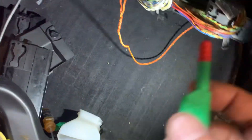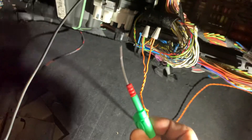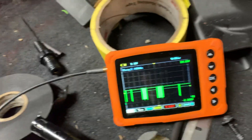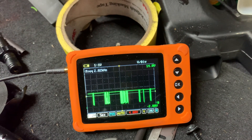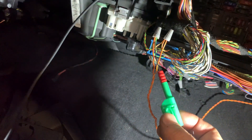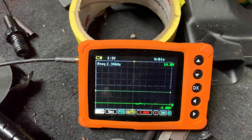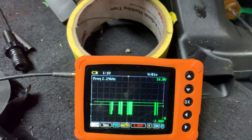So if you're looking at the screen, I'm going to take this — over here I had to fix a bus line. So if I tap in there you can look down there. Now you see the green line, the squares, and you see how the top is green. If I take it out, watch the green drops. In this case they call this a high bus line, meaning it comes from five volts and goes down — and that's the high.